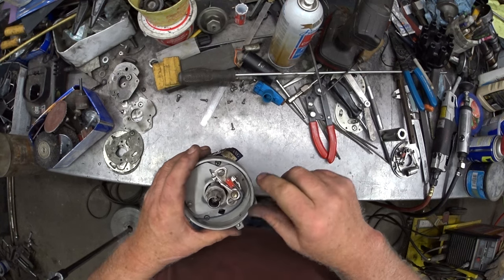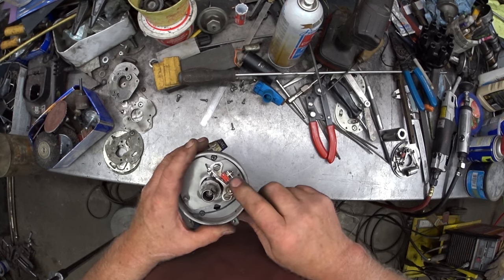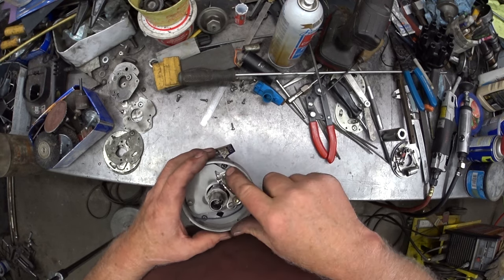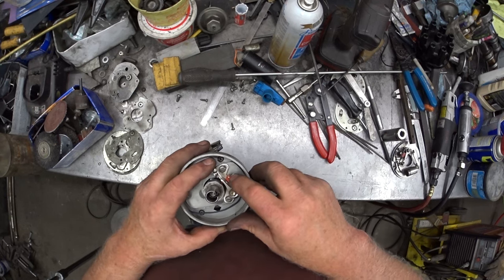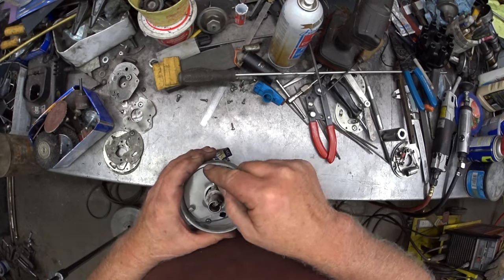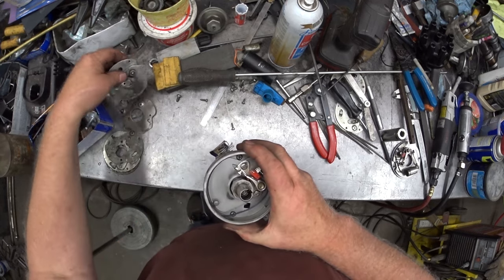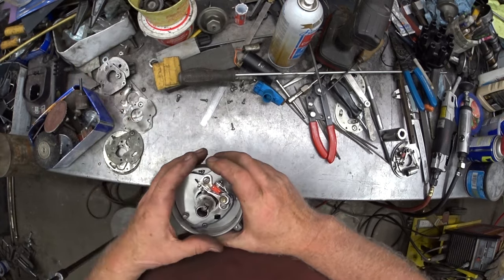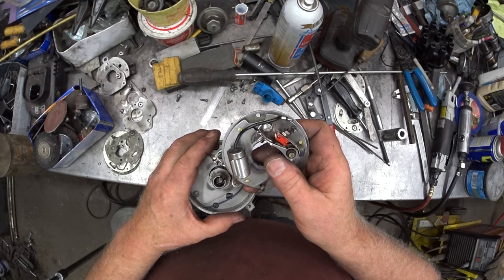It also shows that if this is going to be my zero registration, which it looks like it's going to be, the points are firing in exactly the right spot with the registration where it needs to be. I didn't carve out enough around this screw. There's not going to be much advance going before the plate hits that screw. So I need to, even though this is a replication of the factory hoop-de-doo right here, it's an exact copy of that, I'm just going to scoop it out a little more, which is something I did on my original prototype.